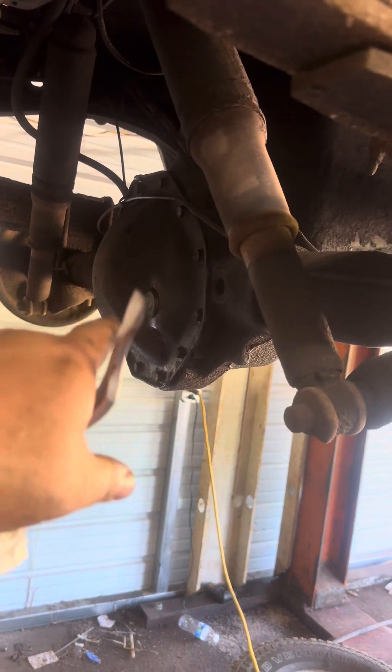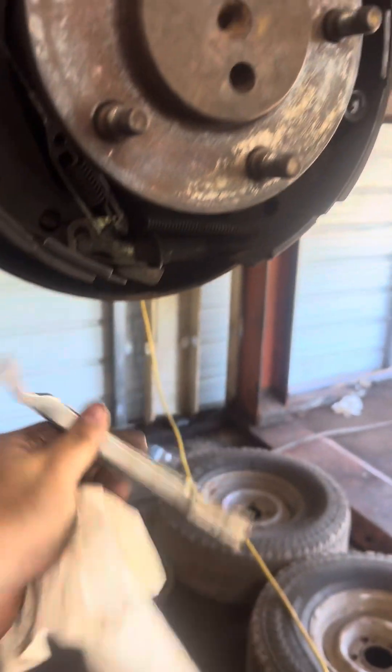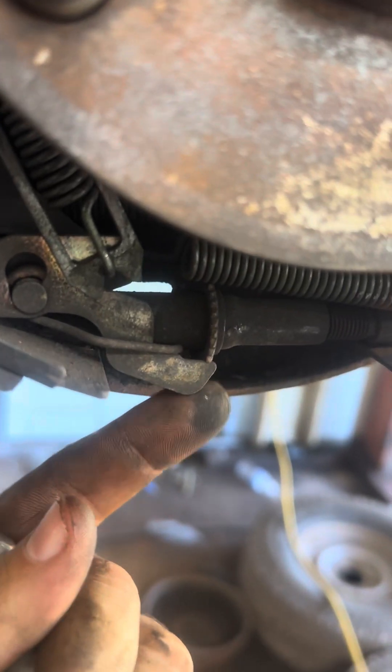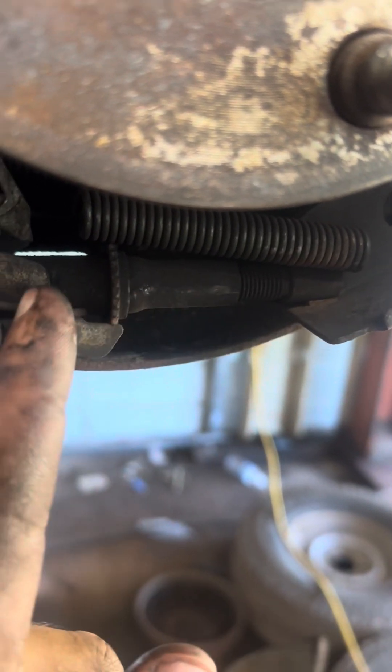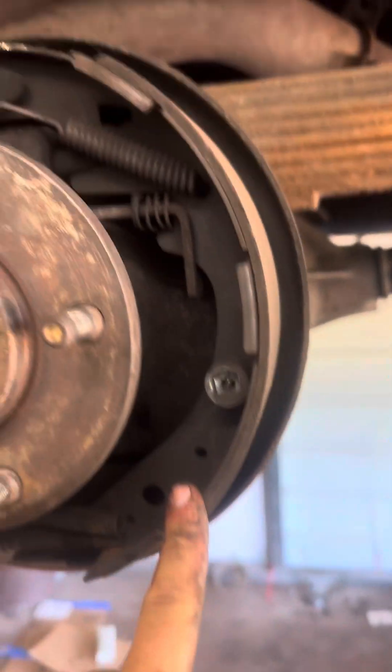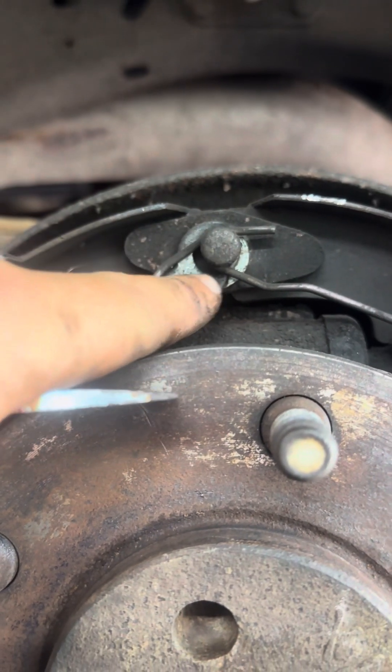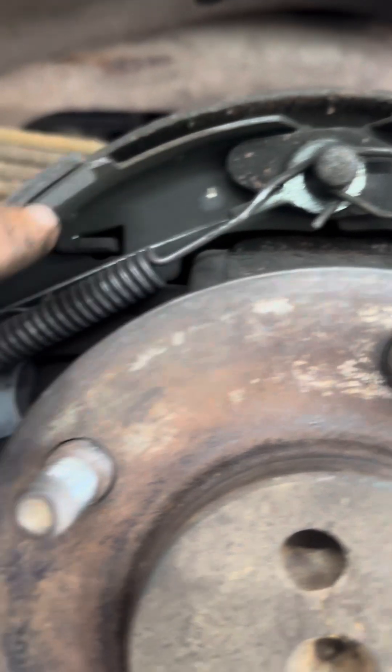I got the diff cover off and gear oil in it. Before I put the drum brakes on, I want to show you this neat little tool for adjusting these brakes. At the bottom you have a slack adjuster — as the brake pads move more than normal, it pulls a cable up on this little finger to expand the adjuster and adjust your brake pads. The factory OEM ones were good, but sometimes these Chinese ends are not correct. You can see how this eyelet is too big, so it doesn't quite adjust properly.